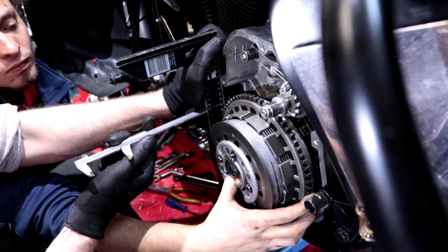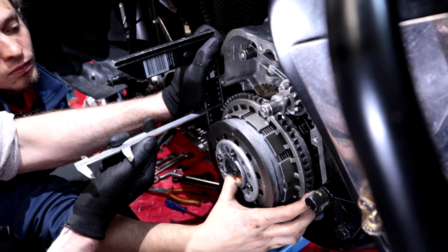Yeah, you see, it's not straight. You can already see. So the chain is not aligned, and the primary chain I'm talking about. That means the clutch part is good, but we can't space that out inward, so that means the compensator sprocket has to come outward towards us. And that's exactly the one washer that we didn't know what to do with. That's exactly what we're doing. So we're going to take the rotor off again. We're going to put that spacer in the back, and then it's going to come out exactly 1.2 millimeters, wasn't it, Mr. B? Yeah. 1.2 millimeters is going to come out.